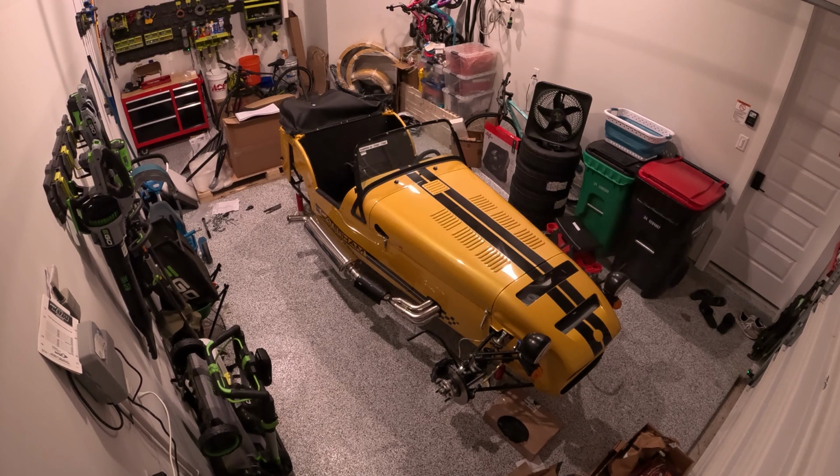The left side went in pretty easily. You have to get washers in between the chassis and the diff, which is kind of difficult. What I ended up doing was using a spark plug gauge to measure the width that I needed, and then combining the number of washers and different sizes of washers to meet that width on both sides. And then as I pushed the bolt through the first hole, I would push the washers up and then pin it with the bolt, and then use the spark plug gauge or a flathead screwdriver to push the washers until they slipped onto the bolt, and then finally align the bolt with the diff threads. The left side went pretty smoothly.